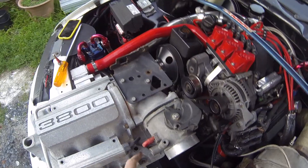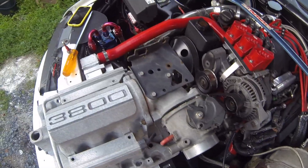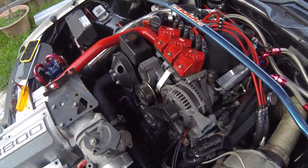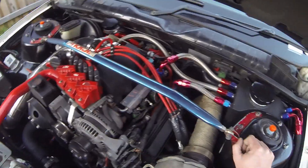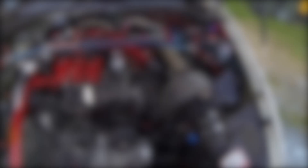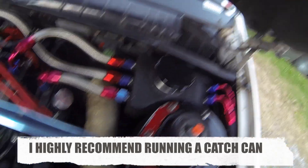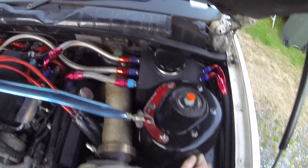Or you can do what I did — a bit elaborate — and have a one-way valve to suck air in only, and then when it's under boost it will just push air straight through the catch can. And then lastly, obviously, breathers on the valve covers — I did both just because I don't want to pull them off again and have to weld them, especially now that they're painted. But you can get away with doing it on one side — it's all one crankcase really, so that should be fine. You need to have a breather there as well. If you decide to run your PCV system to a catch can, you've then got two options: you can either do what I did and vent it back into the turbo inlet — it must be before the turbo because that sees no boost, it only sees vacuum — or you can run a breather or a couple of breathers on top. But the only real legal way is to run it back into the turbo inlet.